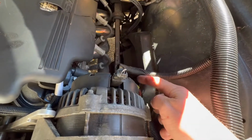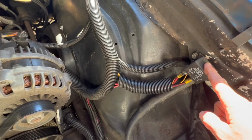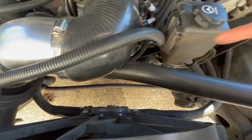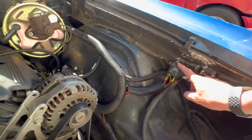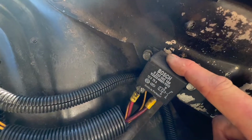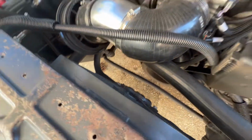Okay, so a few things that we did: we checked power. Our power goes from our alternator to our relay. This is a fan relay. Holley controls the yellows, and then from the relay to the fan. So we'll get the owner to turn on the relay, and we're gonna see if it clicks. All right, turn on power. So our relay clicked, but our fan didn't move. All right, you can turn it off.